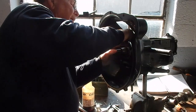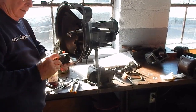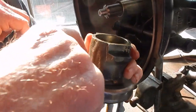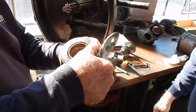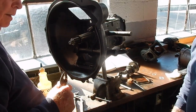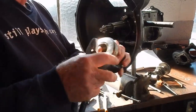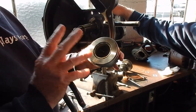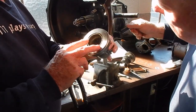You basically pull the spring off and there's the throw-out bearing. Now, this whole thing is a carrier and that's the bearing. This face turns — it's not the outside, it's the inside. The face turns and fits against the levers on the pressure plate. So when you pull this forward, it pushes the levers on the pressure plate. This doesn't slide — it'd wear out if it did. You've got the bearing there to allow this to turn.